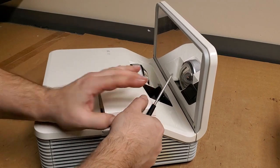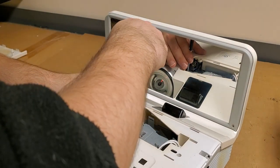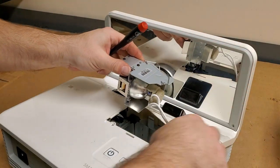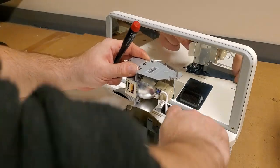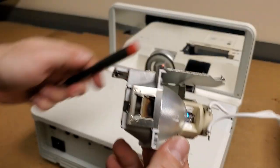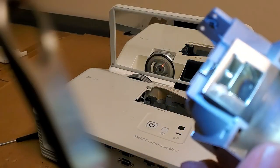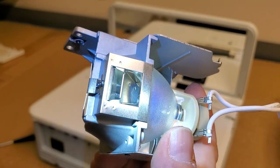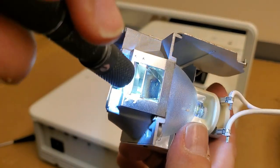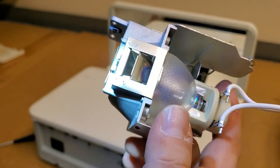Have the audio problem. Pop the door off and let's pop this lamp out. There we are. See, this has similar heat damage — actually it's worse. We'll start here first, gonna do a post-mortem on things. So you see that discoloration right there? That's heat — the heat from the bulb caused that.